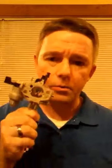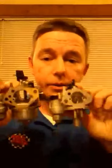But anyway, you get that big 308 cam, you're going to increase the lift, you're going to increase the duration, your center lines and all, but it's probably not going to make this carb work the way it needs to. It's going to throw the fuel signal up and down. You're not going to get enough air into the engine using this that you would using a 390. This is why I tell people carburation to me is the most important part of a modified engine.